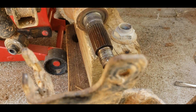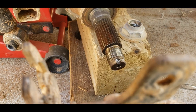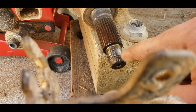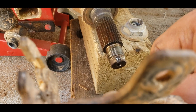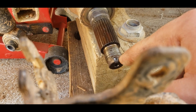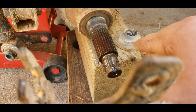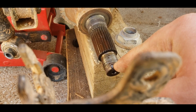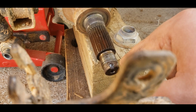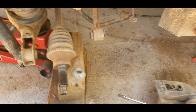It's up to you whether or not you want to stake that out on reassembly — it'll make it a lot easier to get off next time. The best way to do it is to start with like a nail set because that's really small and get in there, then go in with a series of increasingly larger punches. The manual states you should come in with a chisel and chisel it out, but if you wanted to reuse the nut — which you can, you can buy new nuts — then you'd have to be more careful on how you take it out so you can't just chisel it apart.